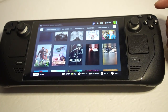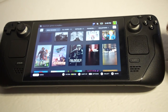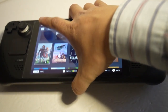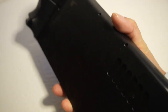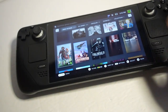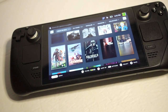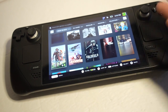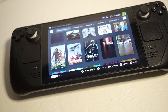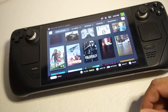This was almost a terrifying experience, but it's working out. I just put in the chip and screwed back everything and it's working — actually I haven't screwed everything back because I wasn't sure it was going to work out. But now you can go ahead and screw back the screws. Right now it's just clamped together — it's a really good clamp when you put the back on. I didn't disconnect the battery; I didn't think I needed to. I've done a few updates and I'm probably just lucky, but you probably should disconnect the battery when you put in the SSD.